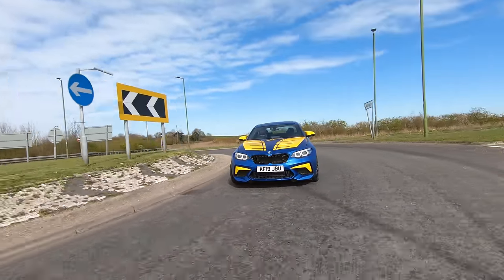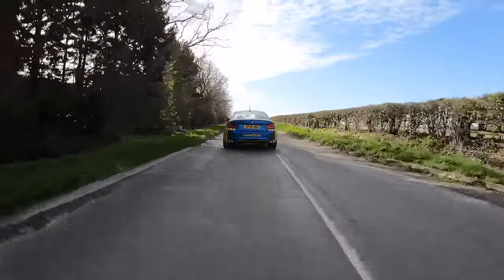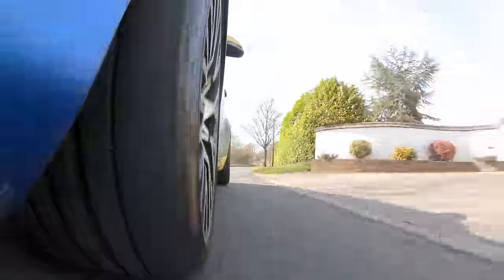It's kind of six of one, half a dozen of the other when it comes to steering feel — the Goodyear is a little bit quicker and heavier, it feels more sporty to steer, but the Michelin is a little bit more progressive and grown-up and slightly easier to place the car. As you start getting to the limit, something interesting happens: where the Goodyear gives you that lovely granular steering feel at lower speeds, as you get to nine tenths — quick roundabout speed, we shall call it — the Goodyear starts to give up a little bit of that information and switches to understeer a little bit sooner than the Michelin. It comes in progressively, which is nice and safe, but it doesn't quite communicate it as much as you'd want. That's the only drawback of the Goodyear in the dry.